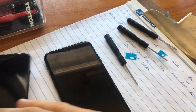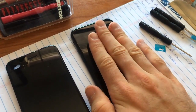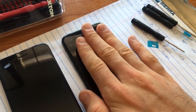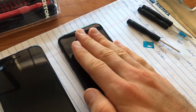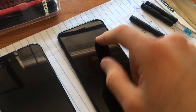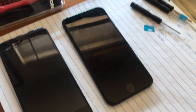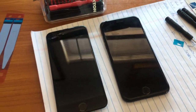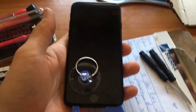If you can see those hooks right there — if you just try to tilt it up without pulling back first, this will happen to you, which is what happened to me. To keep your glass intact, you need to lift up slightly and then pull the phone down to get these hooks to clear the aluminum frame, then rotate it up slightly and take out the ribbon cables underneath the screen on this side of the phone. Then we're going to be transferring our original home button to hopefully resolve this issue.